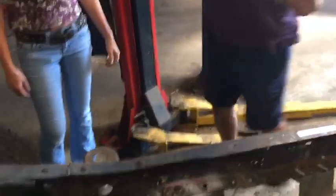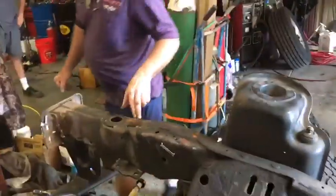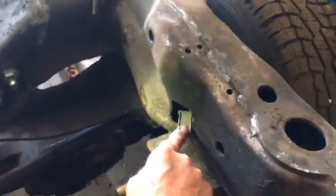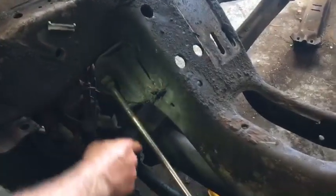And you got to add, a couple more things we're going to have to change out. The steering box has a drag link. This piece right here, let me get the flashlight out. This piece right here obviously doesn't come on a two-wheel drive. It's going to be a bolt hole. Underneath here we have to drill, and also this access for the nut hole. Obviously the steering box will have to come off for that. Also these holes are in the two-wheel drive truck, but we have to steel this bracket.